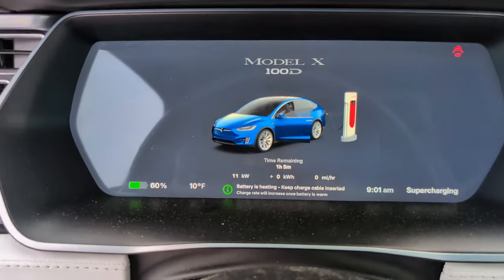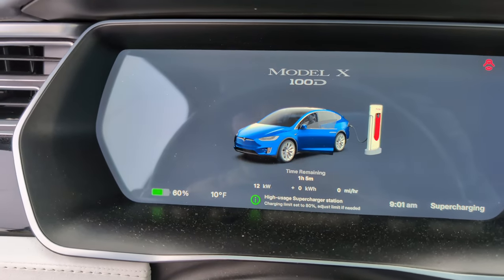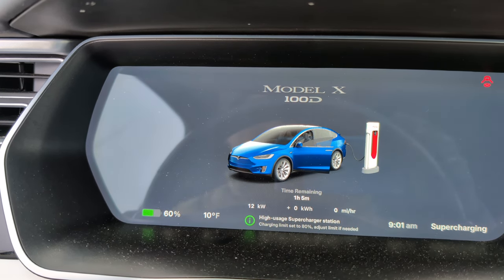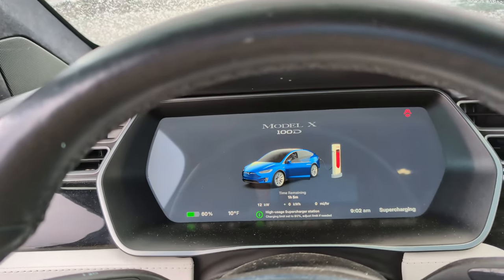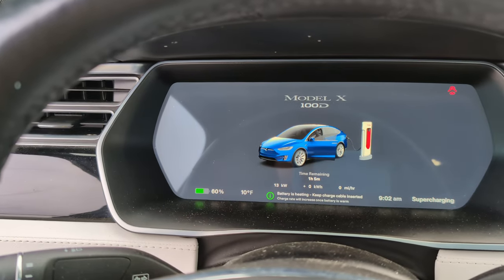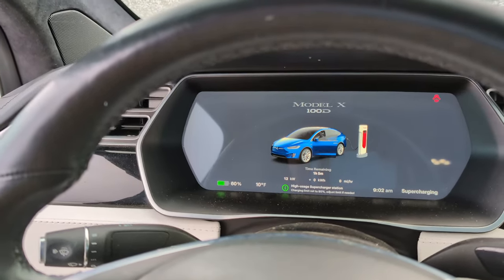It's now at 11 kilowatts — wow — and still nothing going into the battery. For range or charging, 12 kilowatts now. I did turn on my heater, so that must be a really powerful heater — 12 kilowatts, that's amazing. Battery is still heating. I know Out of Spec's Kyle Connor did a test with his Model 3 a year ago, and it took his Model 3 like 30 or 40 minutes before it started taking a charge. I don't want to wait that long. We're now up to 13 kilowatts. So, the charging does work, but it does this if you're at these extremely cold temperatures. I think I'm going to end the video here.